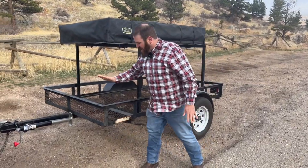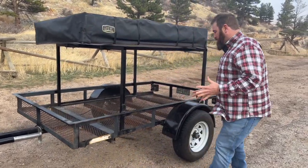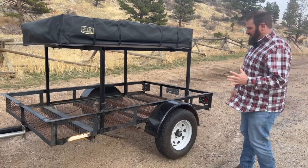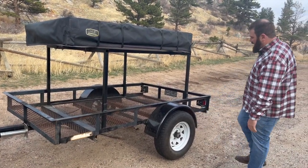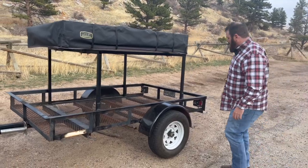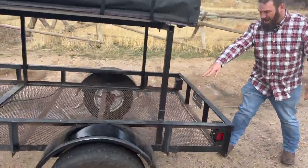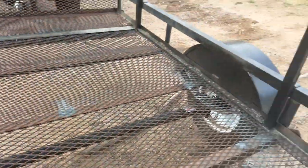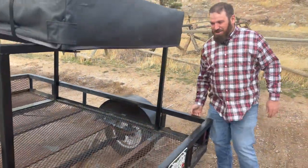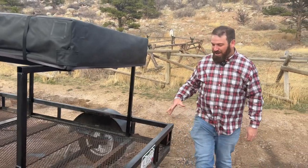What we have here is actually a utility trailer that the previous owner chopped up. He said it was like a 2006 utility trailer. He put a bigger axle on it, so it does have an upgraded axle, which is good. He also flipped the leaf springs to put them on top of the axle instead of below. But yeah, it's really light — me and Tymon were able to just pick it up and move it to put it on the Jeep.